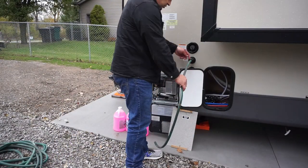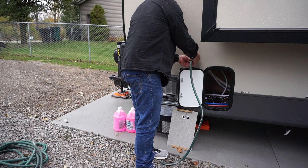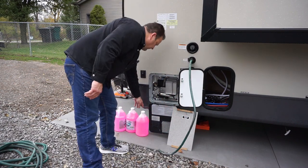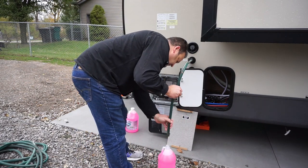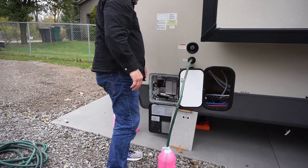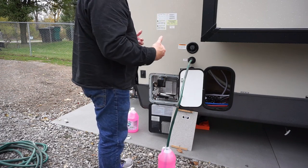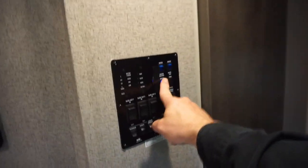What we're going to do next — I've got an old piece of hose here, and I've got it strapped into the antifreeze inlet. When we turn the pump on, it's going to draw antifreeze through the hose from these bottles. We're going to use two, three, maybe four of these. It's antifreeze introduced directly into the system. So we're going to flip the switch and then go to all the valves until they run pink. I've got a new jug of antifreeze hooked up to the hose — let's see if we can get some pink flowing.